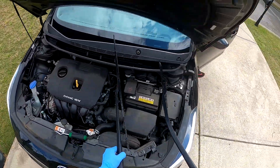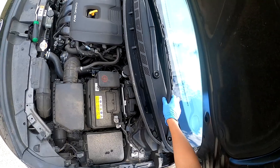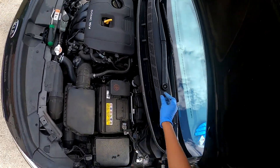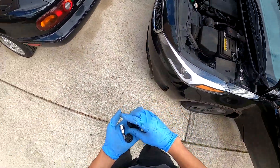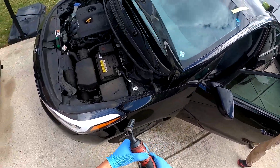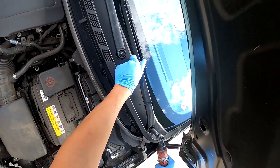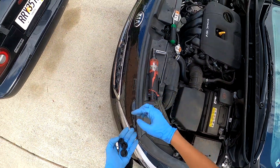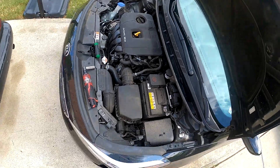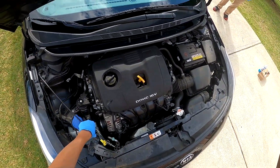Go ahead and put your wipers on. The shorter wiper blade goes on the passenger side and the longer one on the driver's side. Memorize where the wiper blades were before you took them off — or you run the risk of the wiper blade swinging all the way off the glass on the driver's side, and you also don't want the wiper arms hitting each other. Tighten them back up. Even though you're using an electric tool, go back and do it manually as well — just a little tug to secure it, but don't overdo it and break the wiper motor.